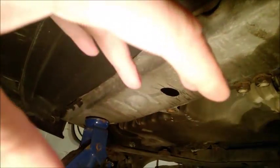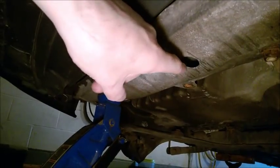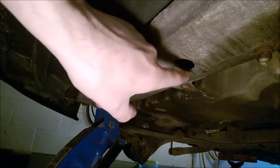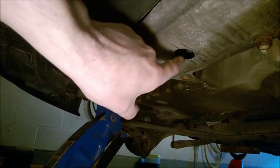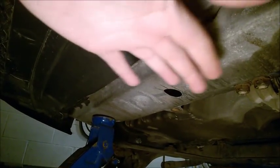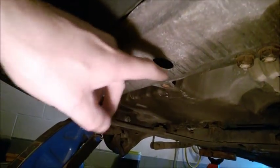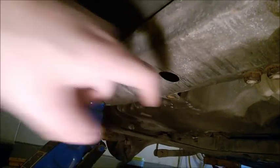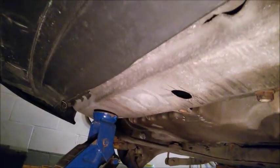When you have finished the job and you put everything back in place, don't forget this mount bolt, 14 millimeters. It is possible that the holes will not be aligned to insert the bolt easily or to turn it easily, and that may be because the subframe at that point is not aligned with the engine. So maybe just play a little bit with the jack, lower the subframe, try attaching first the subframe bolt, see how it goes for that bolt, just to move a little bit the subframe and align the holes. Again, try not to drop the bolt inside there.